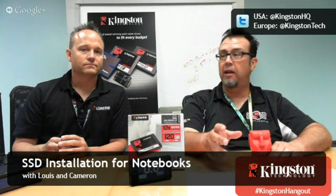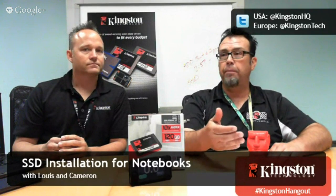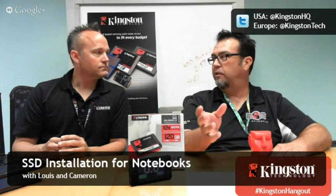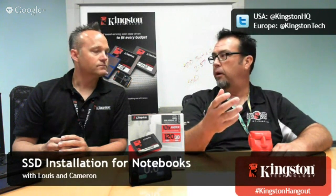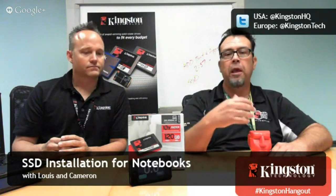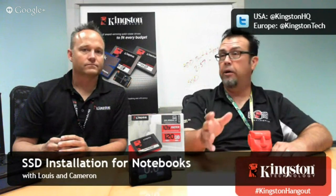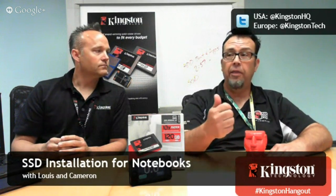There's a series of tantalum capacitors on there, and should there be an unsafe power drop to that server, the SSD, actually the controller we use, has enough intelligence to detect that power drop. It'll disconnect from input power and fail over to the capacitors and allow a graceful shutdown. Any data that's in transit will be hardened to flash, and the drive will shut down nicely, essentially. So I would say that's one thing.